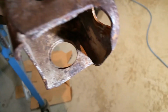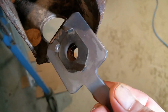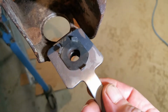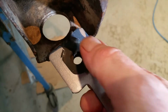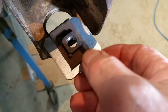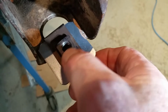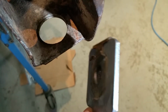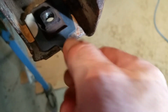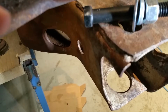If you've got an early car and one of these and the clip's messed up, you can take this metal tab, if it's still in one piece. What I did was I bought a 1.25 washer, drilled a hole in each side of the washer and MIG welded it to this plate. Then on the top side, I welded a nut. I didn't have a square nut, but I welded a regular nut on a couple sides, lining it up. So basically it does the same job as this, and it looks the part. If you can't get anything else, it's better than what comes with a mounting kit.